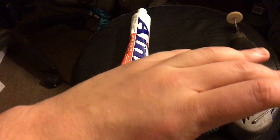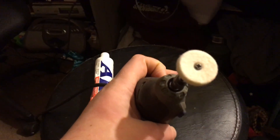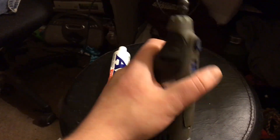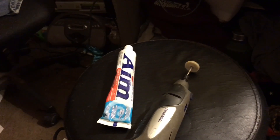You want a soft, wide head for your Dremel. I've used the smaller heads but thermally I don't think they're a good idea. You want to keep the Dremel on the lowest setting and make sure the head is very wide — a larger circumference — because the smaller heads tend to get hotter faster and you can run the risk of melting the disc.